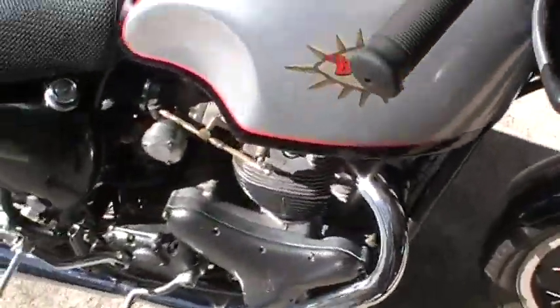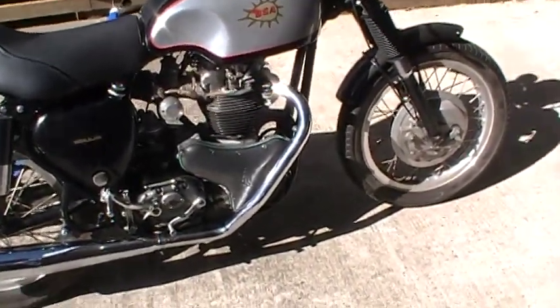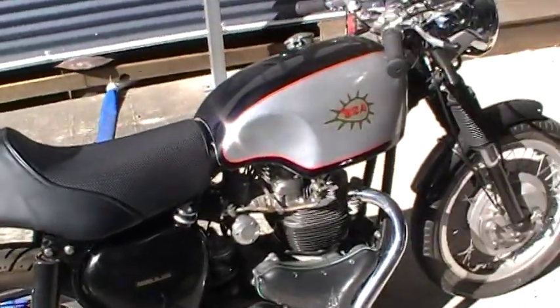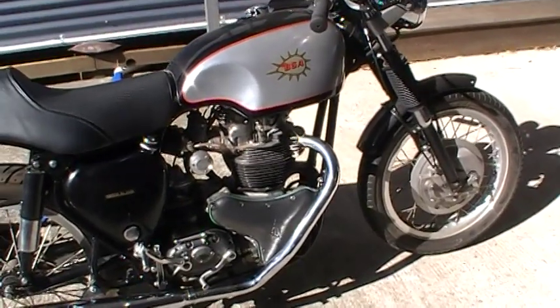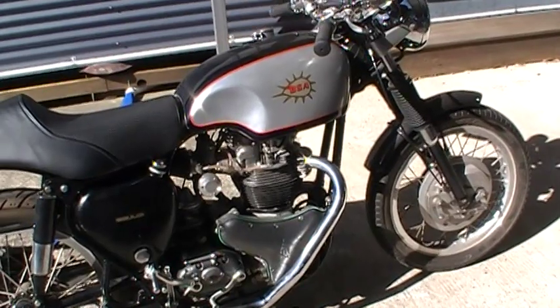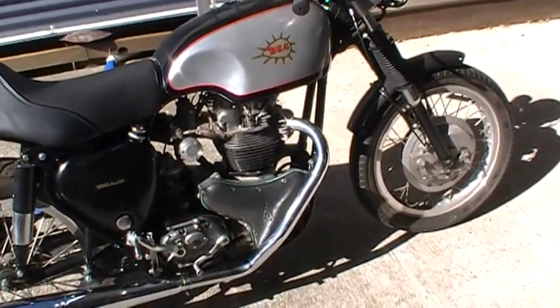Right, couple of kicks there. Wants to kick back, added a bit of advance on the leafer. This is a little Rocket Goldie thing that I'm trying to get right. It's almost ready, but it's got a little bit of smoke because I think that head is compromised. Someone's been in there and gouging it out a bit, and there's a bit of DevCon, and I've got a feeling she's pulling a bit of smoke down the inlet.